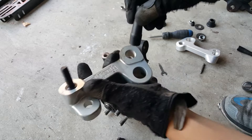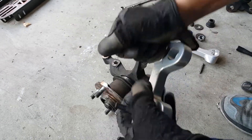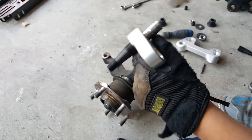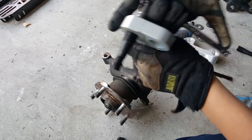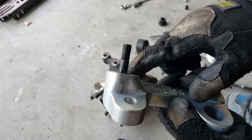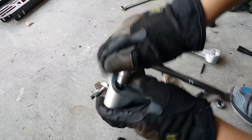The bigger one — this is for the lower control arm. Remember that this is reverse thread, at least from the back. So I'm going to screw it in hand tight. There is a hex on the back — I believe it is 10 millimeters. And you're going to do a reverse of what's intuitive — you're actually going to go what is normally the loosening motion to get this in. Make sure it's nice and snug. Now going back to this one, you see how it's protruding a little bit. I'm going to get my 8 millimeter hex and do the same thing to tie it down.